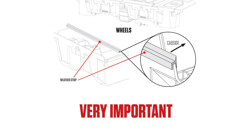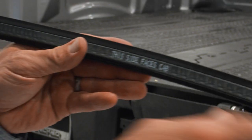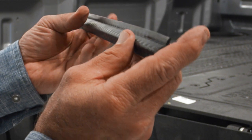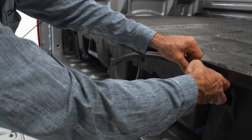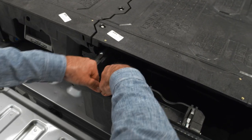We're going to put the weather strips on — it's really important that you get these on the right way. It'll say on the back 'this side faces cab,' which means that side faces the cab. It's also angled, and you want the point of the angle pointing towards the cab. If you put them on correctly it's all good, but if you put them on backwards it becomes a funnel and will put water right into your drawer. Make sure you put these on following these instructions.